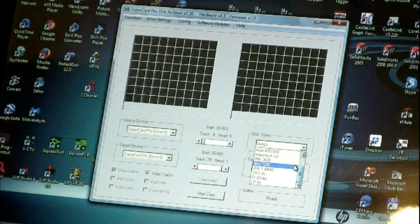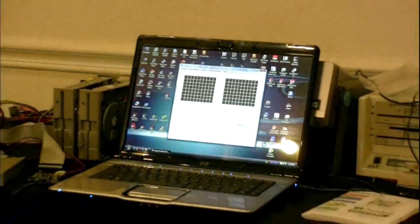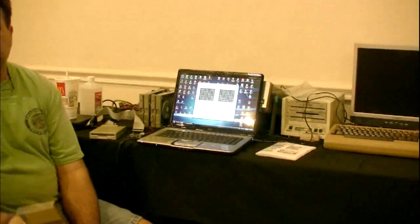I also have conversion to G64, and one for ADF for Amiga. I've got a ton of Amiga disks that don't read real well, but I'm able to extract all the data successfully because I can adjust the clocking windows so well. I can pull disks that are bad in my Amiga, read them, create an image file, and then write them back — basically I resurrect the disk. I'll be doing the same thing for Atari ST, which is the same format as PC. I'll have everything covered as far as what we call recovery for all the different formats.